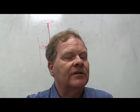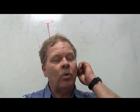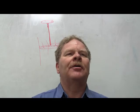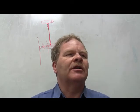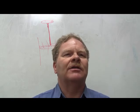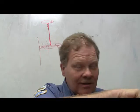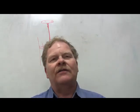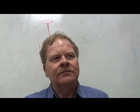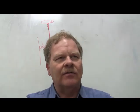The acceleration signal is provided by the PCM to the suspension control module to activate the suspension to do what? Now, on the supercharged Thunderbirds that we used to see, when you really get on it, if you had over 400 pounds of braking pressure, or if you turn the steering wheel at a certain rate, real fast, like a swerve, or if you went over 80 miles an hour, the shocks got hard for cornering, to make you less likely to turn over. See what I mean? And then they would get soft again whenever those conditions went away.